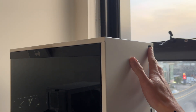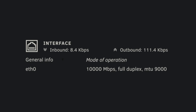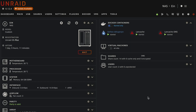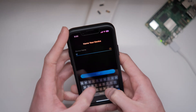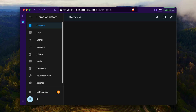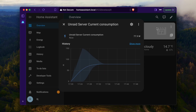When I built a new gaming PC, I decided to use my old one as an Unraid server. I've upgraded it with various things like more RAM, more hard drives, and even a 10 gigabit PCIe card to allow me to edit my videos off of it. It's running an old i7-9700K meant for overclocking, so saying that it's overkill for a NAS is an understatement. For the first integration, I want to start monitoring how much energy my Unraid server uses so I can potentially optimize the machine for that metric. I picked up the Tapo P110 smart socket with energy monitoring, and it was really easy to add to Home Assistant. I had to use the Tapo app on my iPhone initially to connect the device to Wi-Fi, but once it was configured, it got picked up by Home Assistant immediately as it supports Tapo integrations out of the box. Looks like my hunch was right — my Unraid server is consuming a lot of energy, but that's to be expected as it's running my old gaming PC's hardware. I'll make another video to see if I can bring that number down.